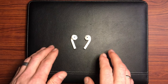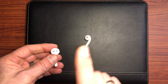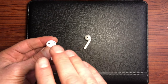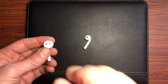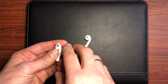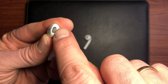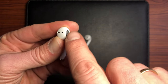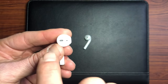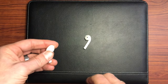AirPods are very easy to maintain and clean, as long as you're consistent in doing it. Sometimes, for whatever reason, AirPods are going to tend to get clogged up, and this is very common for people who produce a lot of earwax. What happens is that earwax and other debris clogs up these screens that cover the speakers, especially on this front main speaker that's larger. They can also get in here on the side speaker, and they can also affect the ear detection.